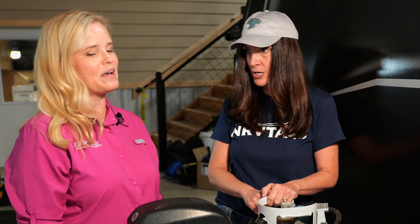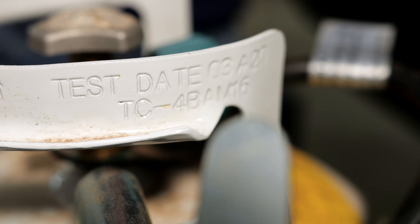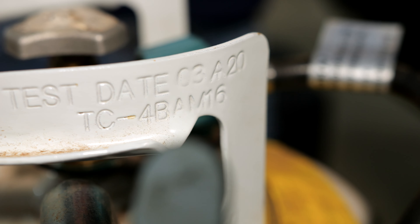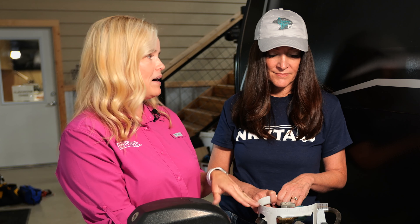When you're taking a look at your propane tank on your travel trailer — or it's actually considered a cylinder, the propane cylinder — you want to know what kind of condition it is and how old it is. That's probably the most important thing. Just like our tires, our cylinders have a date of manufacture, or a born date. This one, it's going to be right here on the collar. This one was 03 of 2020 — March of 2020 — so this is a pretty new tank. These cylinders are certified by the Department of Transportation; they're good for 10 years, so this tank is going to be good until 2030.